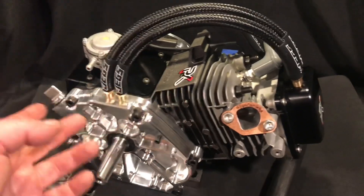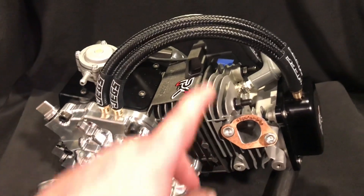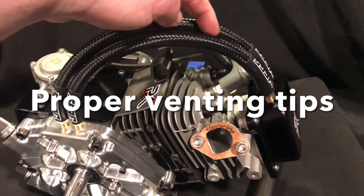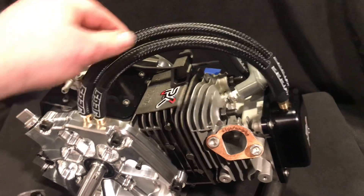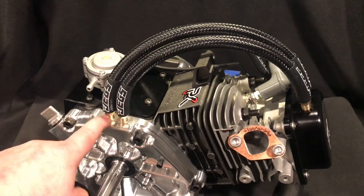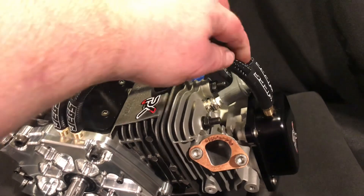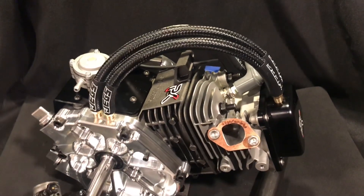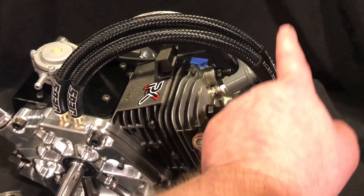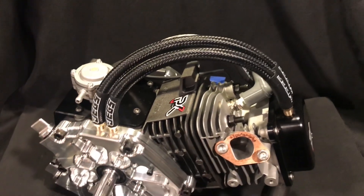This isn't proper venting on its own. You could cut this one in half — on one half install a PCV valve to a breather filter, and on the other half turn it to go into a puke tank. So venting the block out to the puke tank, you'd have a PCV valve; this one leaving the head, cut in half, would just have a PCV valve to a breather filter. You'd connect block to head on one side, side cover to puke tank on the other, and side cover to breather filter. Both the breather filter line and the block-to-puke-tank line would each have a PCV valve.